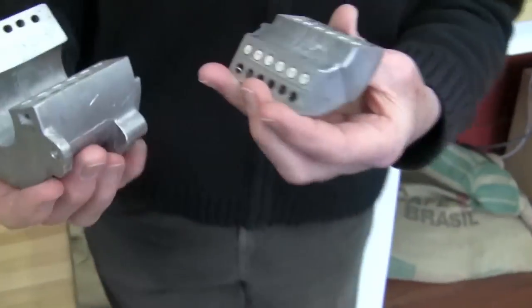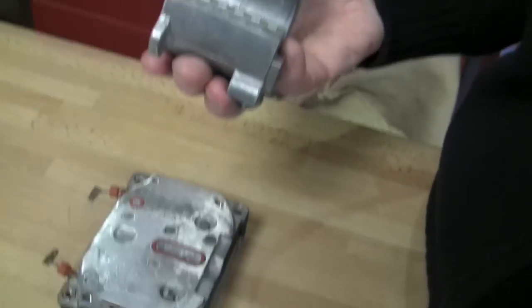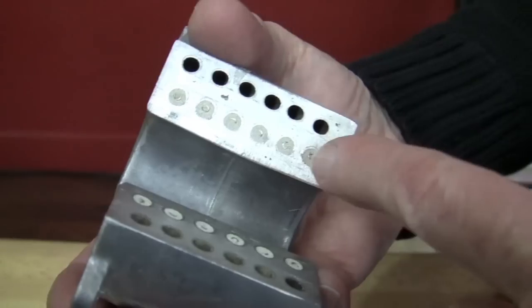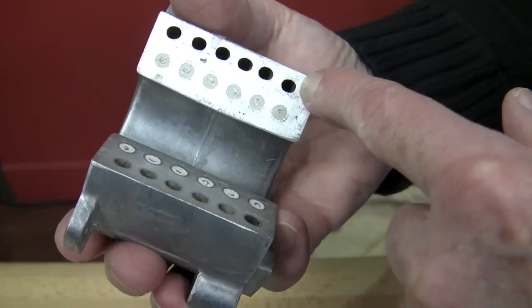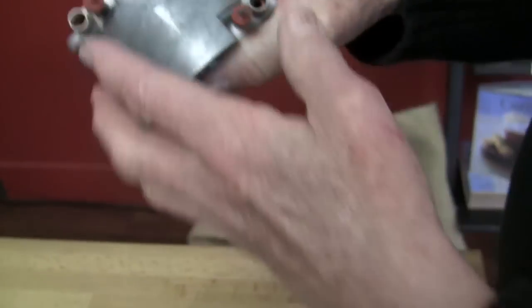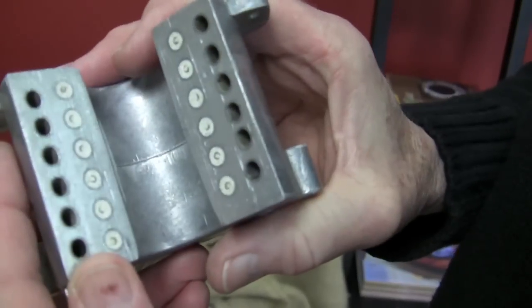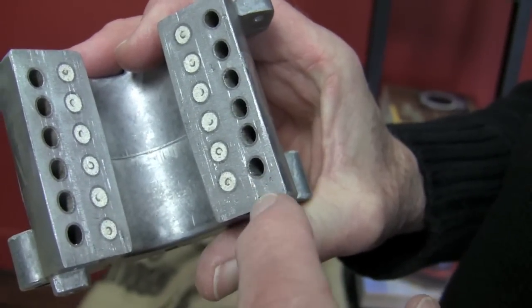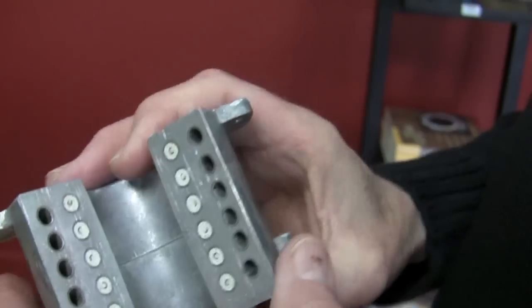What they did was create the new and improved - this is technically a thermocoil. They sawed this apart for us. The white stuff you see is the actual heating element - it goes around and around. This is where the water chamber goes in one end and out the other, like a spiral going down. This is stainless steel lined aluminum - you can see the lining with a slightly different color. It's one unit, so you don't have any seals or gaskets to leak. These are more efficient and have better temperature stability.